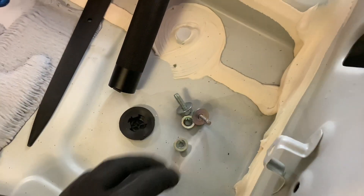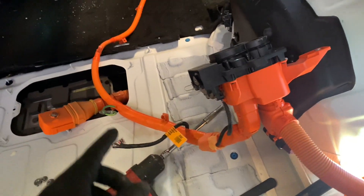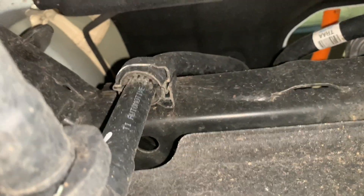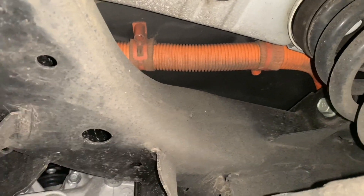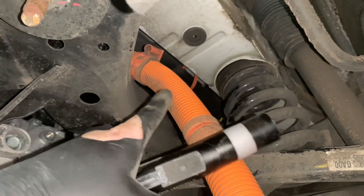Four fixings to remove — obviously make sure you've got your caps disconnected. The only thing left now is to lift the vehicle back up and run this wire out, because there is a bracket underneath that keeps it bolted in. So we're going to go under now and get that removed. This is the worst part about the job. Down by the traction motor, just up in there, just above it — there are two 10mm bolts on a bracket holding that wire to the top, and then around the back we've got a couple of clips.